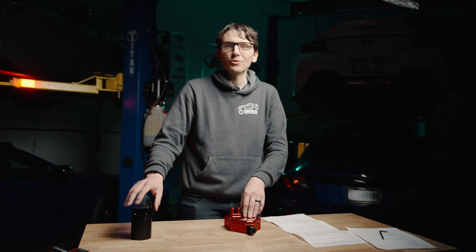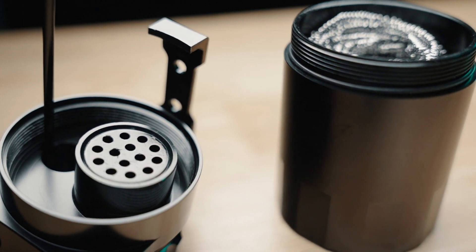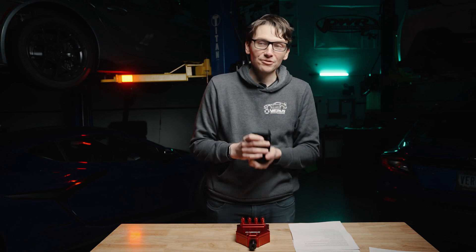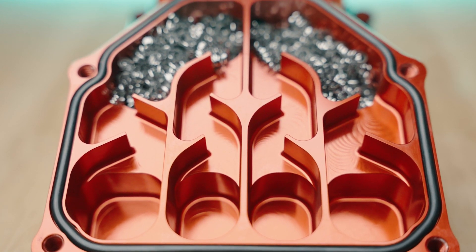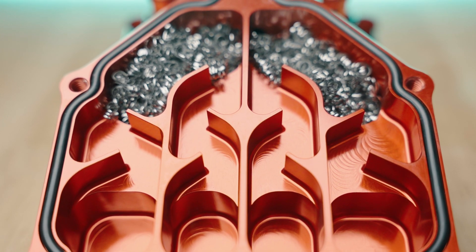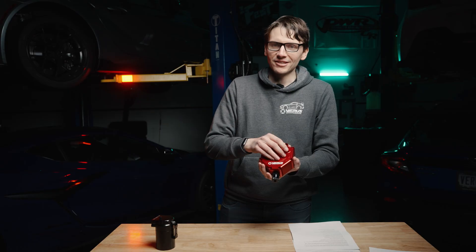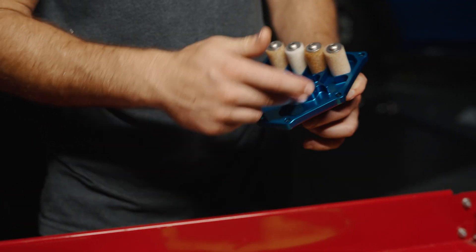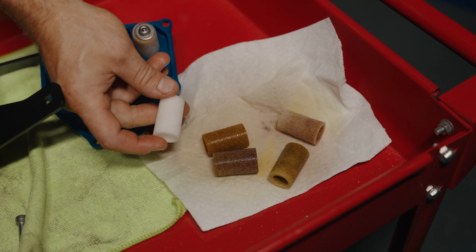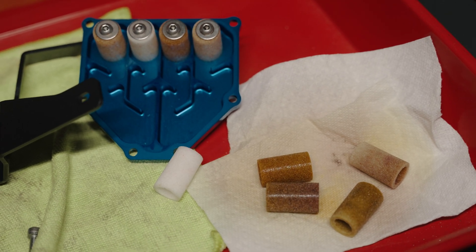I have personal experience with both. I actually had slush suck up out of an oil catch can — I think it was this one — and it sucked the condensation into the crankcase, adding a bunch of positive crankcase pressure. It's really dangerous for your motor; mine was gone after that. The other major benefit of the air-to-oil separator is it reduces the potential for knock through reduced octane levels from having oil come back into the intake track. If you get oil back into that intake track, it reduces performance and can cause detonation issues, which is permanently damaging to a motor.